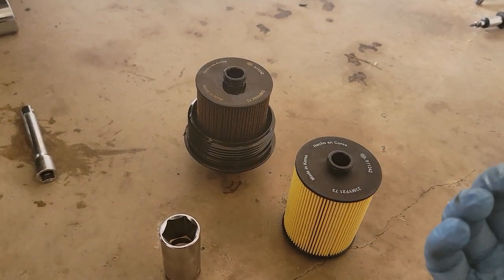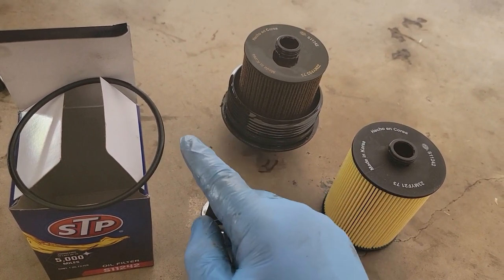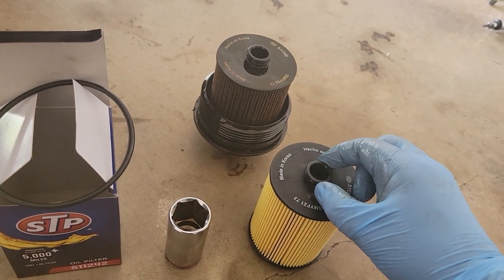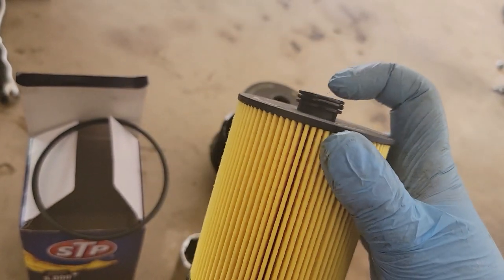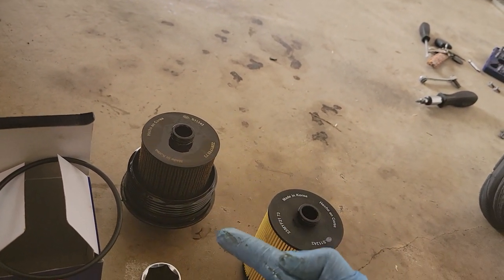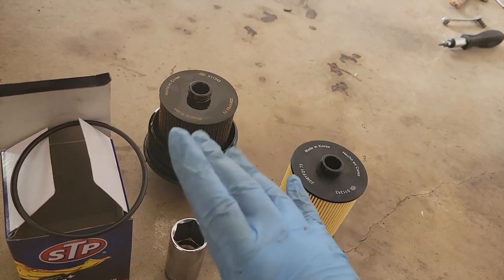When swapping out the filter, there are a few things to make it easier. You've got an O-ring on the last thread that needs to be replaced. What I like to do is get a bit of oil around that O-ring, then press the filter up into place underneath the car, then take the cap — making sure the drain plug is back in first — and screw the cap back up to the housing. This ensures nothing gets crunched or misaligned. Once the oil filter is back in and everything's closed up, since I don't have a torque wrench, I get things snug and then try a quarter turn more without forcing it.